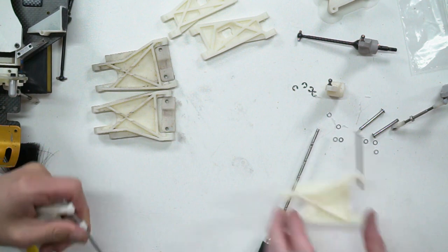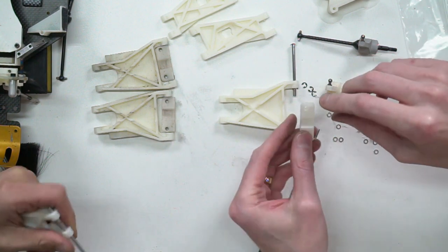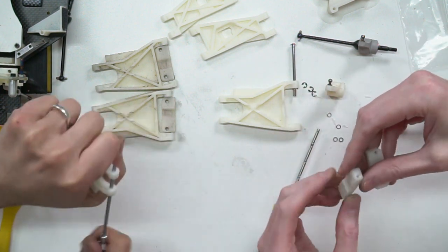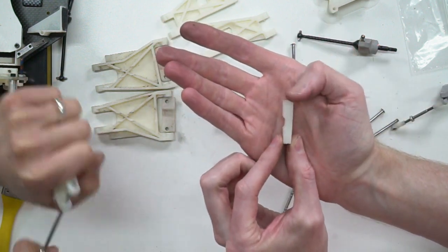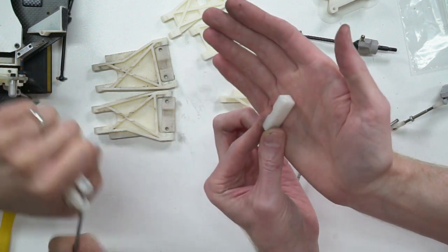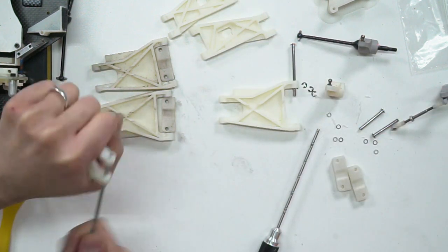When I was researching the design of these arm mount parts, I couldn't work out if it had an inboard toe or not. I looked at lots of different photos and couldn't determine it clearly, so I wound up going with basically zero toe at the inboard end. All of the toe - three degrees - is in the outboard part of the arm because the hubs are zero. The inside mount is zero and the three degrees is in the outside of the arm. It's also got three degrees of anti-squat - three degrees inclination of the hinge pin. You can see the mounts are thicker at the front end and thinner at the rear end to allow for that anti-squat angle.